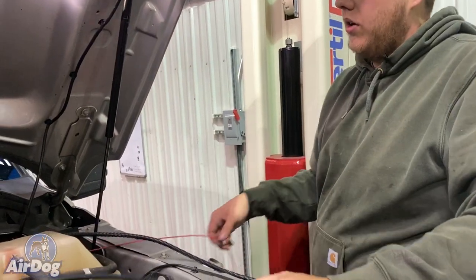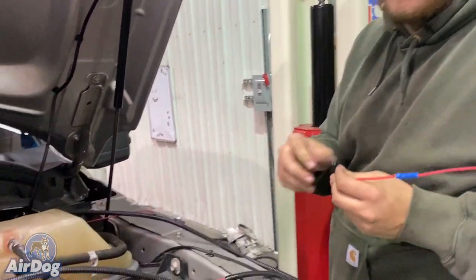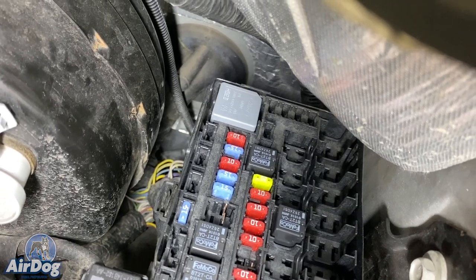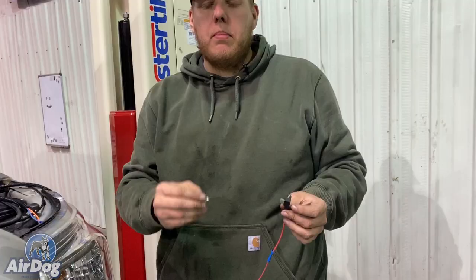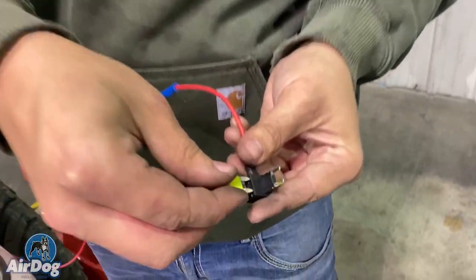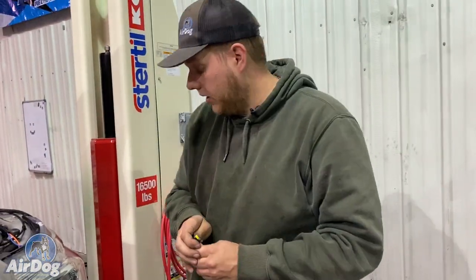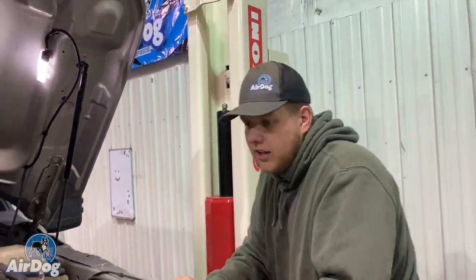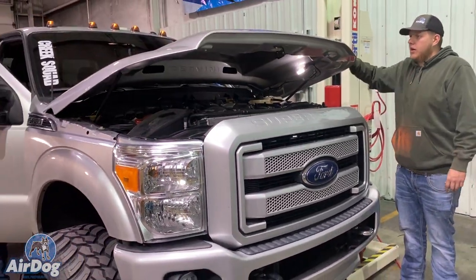Get the key-on fuse tap installed. On this particular vehicle, we're going to use fuse 56 — it's going to be key-on. That's going to be the fuse that turns the interior fuse box on, so anytime this vehicle is remote started or anything like that, it'll turn on — good constant fuel pressure at all times. The fuse that you remove to install this in the fuse box will always go back into the open side of this, retaining your factory circuit as well as adding our two-amp circuit. Wiring all tucked up nice and clean, hidden out of the way — we're going to get the hood down, get this truck back up in the air, and finish the wiring on the bottom side of the truck.